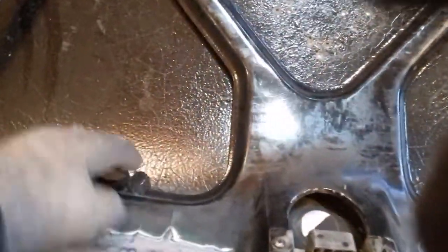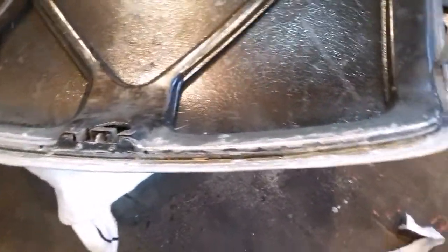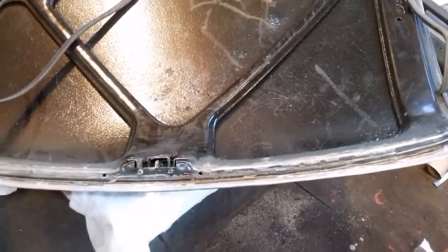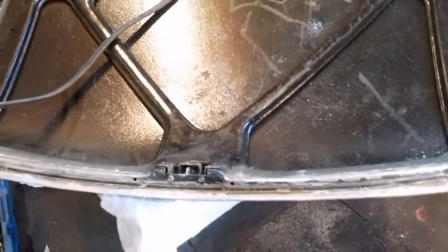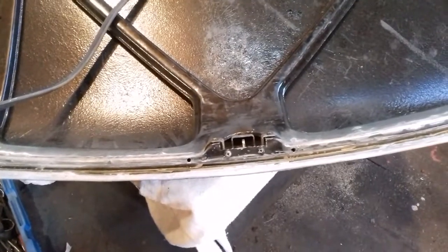What I'm going to do is get some paint and pour it down the back here so it soaks all that new metal down there — I'm going to pour some neat paint down there and get a good load in. Might take a photo when it's painted. I think it's alright — I think this is better than trying to make a new piece. You can see the curve on that piece there — it's okay making a curve on a straight piece of metal, that's pretty easy, but this is curved all ways. There's a subtle curve, a crown on it as well, and if I'd ended up making a new piece I'd never have got that crown without using filler. So I think this is the best way to do it.